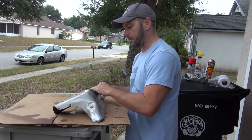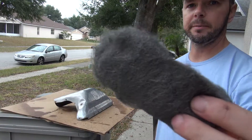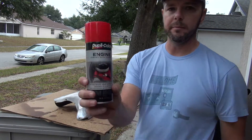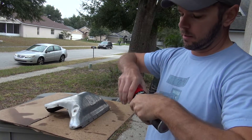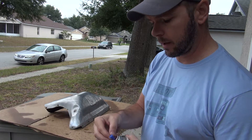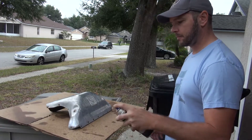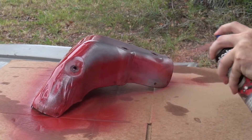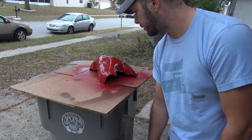I don't feel it roughing anything — if anything it's probably making it smooth. One of the things you want to do after you steel wool is wipe it down, because it's made up of tiny little fibers that could get everywhere. I'm using the same red engine paint I used to paint my valve cover, using more of a longer stroke technique. It seems to be going on really, really well. We'll come back in 10 minutes, put on another coat, see how it goes.